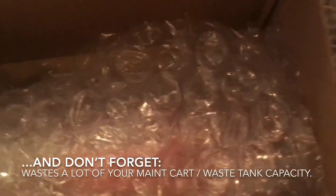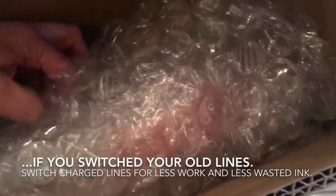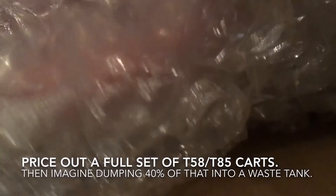If you had one of their technicians install it with a service manual, that would have cost a lot of extra money — plus they need an adjustment program which is not freely available — and they would have purged or recharged your ink system, which wastes almost half your ink. Really, all you have to do is keep switching between the two different blacks and it won't waste the rest of your ink. They benefit when you waste ink and have to buy more, and they benefit when you have to buy a huge part. I had intended to use an ultrasonic cleaner with syringes and ammonia, but just soaking in hot water and working it a bit seemed to be all it took to clear it up.